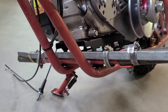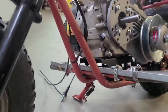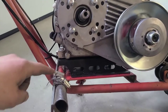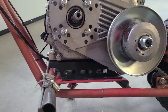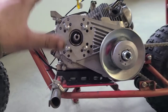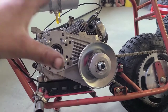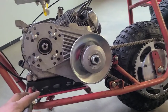All right. So the big advantage we have is our OMB plate here, guys. That's what makes this possible. Otherwise, you're stacking these things on washers or spacers, and you're still not going to achieve this. You need to get this motor up and over that cross member there. I've seen guys mount plates on top of these and do all kinds of things. This is the closest thing to no fabrication besides cutting those holes in the frame. And we did that with just our step bit and a file. That's it, guys.